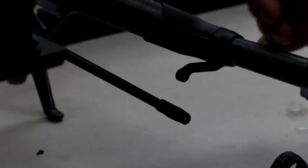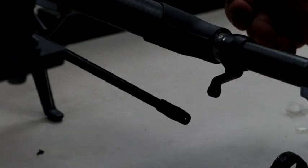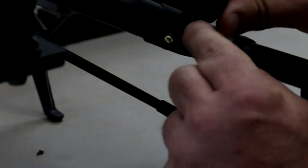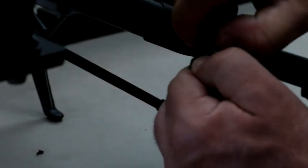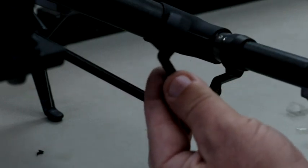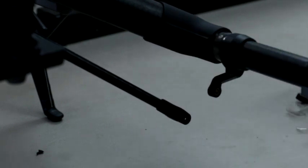The one thing that we see online a lot of times is a lot of people with the loose arms are saying, hey, just take a T9 and tighten that screw. Well, you can sit there and tighten that screw. Yeah, it's going to work for a while. Another week later, it's going to be loose again. You're going to tighten it, and eventually that screw is going to be so tight. There should still be somewhat of a gap. These two pieces, this part and this part, should never be touching. I mean, that's way too tight. And then what happens is you'll start to see a bend and a crack right here, and that's toast. You'll need a new arm. You can't buy just these, and you're going to need an entire new arm. They're about 140 bucks depending on where you get them from.